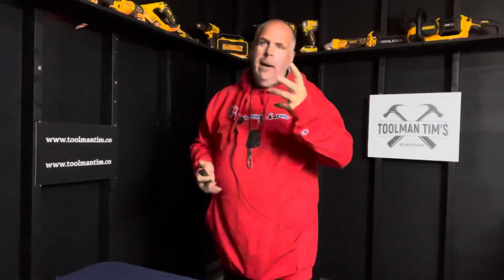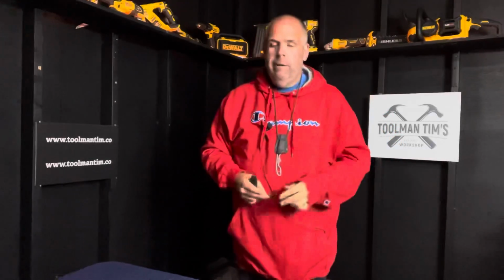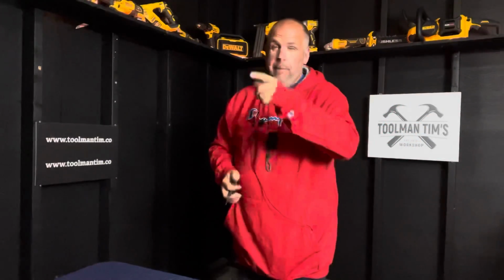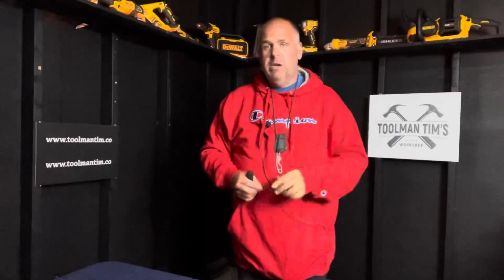And a couple other items to keep in your tire repair kit that don't come with a lot of them. Give yourself maybe a cheap throwaway pair of pliers, vice grips, something. You're going to need something to pull whatever the sharp object happens to be out of the tire. So keep a pair of vice grips or pliers in there. That works good.